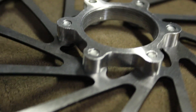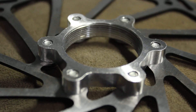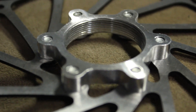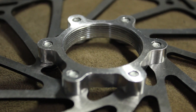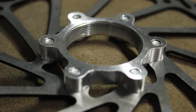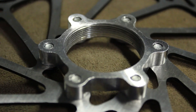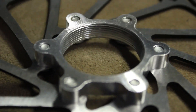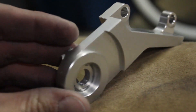So that's an adapter piece. This is where I say it's not perfect — this is an adapter piece that goes onto the freewheel side. If you know how a fixed hub works, it has two different levels of threading; the second level is smaller on the outside so you can put a lock washer on there. Well this is just the top, so this is why I say it's not perfect — it's not threaded onto all the threads the hub has to offer, but it definitely does thread on there very well.